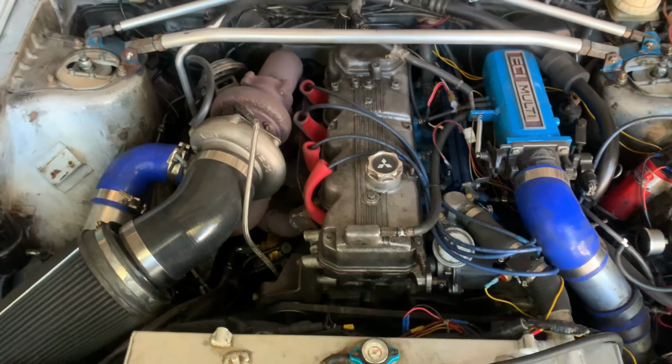Okay, so we got the intake off, intercooler piping boot off, feed line off. Another thing I wanted to tell you guys before I finished taking this turbo off. This turbo, which is a GT35R dual ball bearing, is perfectly fine and in 100% working order. I am not going to be using this turbo in this application. I actually plan on upgrading to a bigger size. So once my racing long block is done, all I have to do is button up the same turbo and intake manifold, and then basically give it the beans. But I say that to say that all of this is gonna pretty much disappear except possibly the return line.